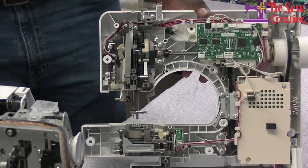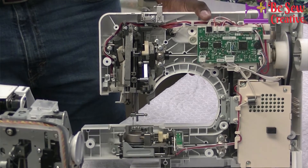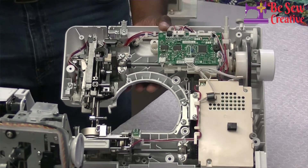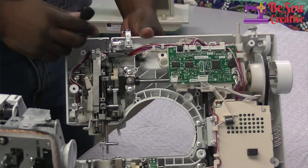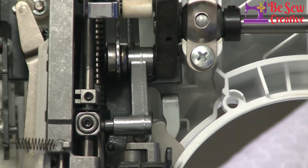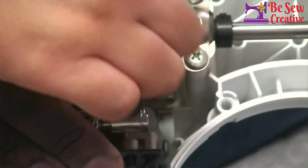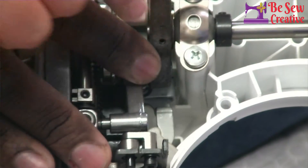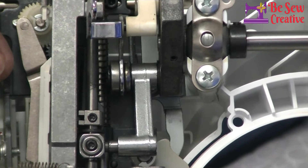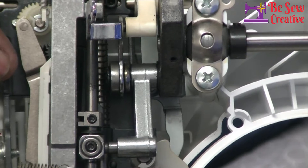These machines usually tend to go for a cheaper price, so if you're a beginner sewer looking for a simple machine that doesn't cost too much, these are always nice. But to show you one of the disadvantages of having a plastic inside — there's a crack right here. The reason there's a crack there is because someone using this machine was either using a really thick fabric or thick thread, and the machine just wasn't taking it. Instead of giving way at the fabric, it gave way here in the plastic.